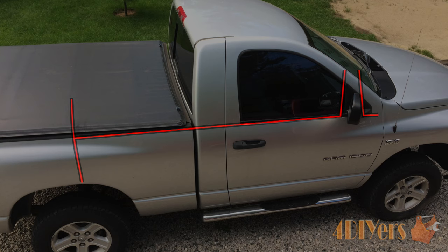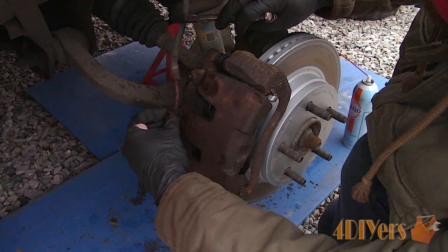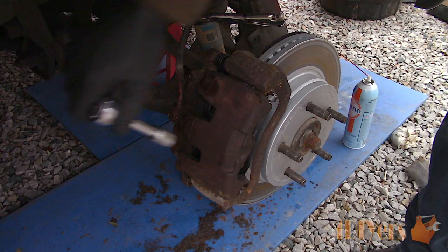Typically vehicles are broken up into brake circuits. For this truck it's split between the front and rear. I only did work on the front calipers and considering I didn't let the fluid reservoir go empty, there should be minimal air in the system and there's no need to bleed the back brakes. However, I will still verify the pedal feel, which I'll talk about further on. The master cylinder is located on the driver side of the truck, therefore I need to start at the furthest wheel affected — that would be the passenger side. If I was working on the whole system I would start with the rear passenger side instead.